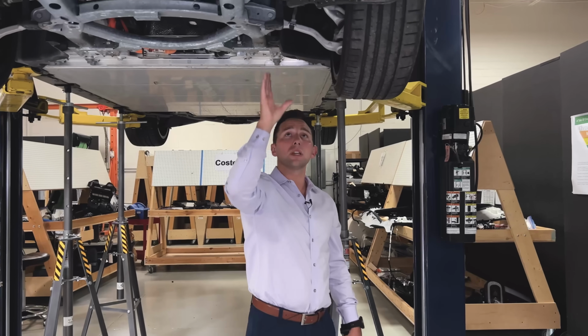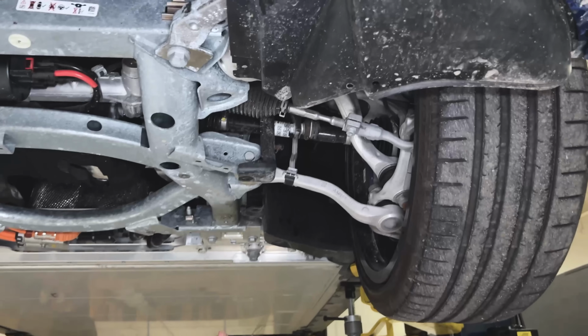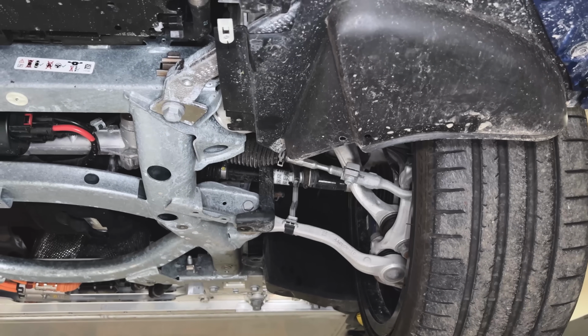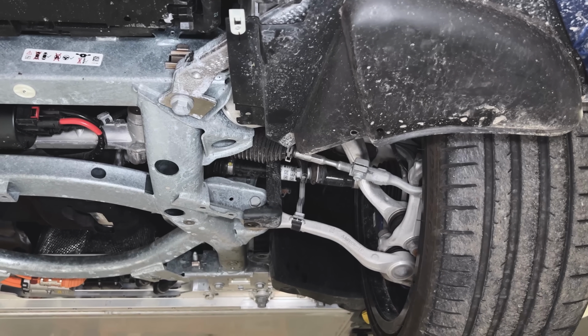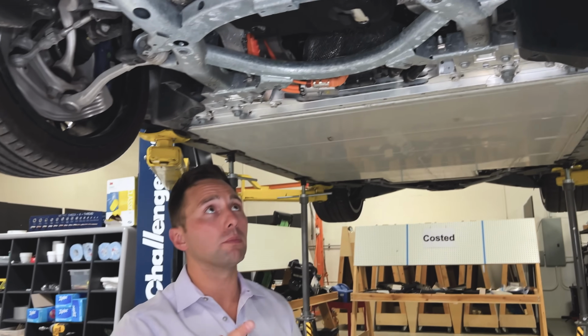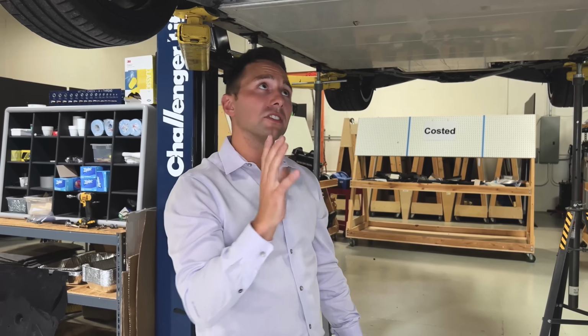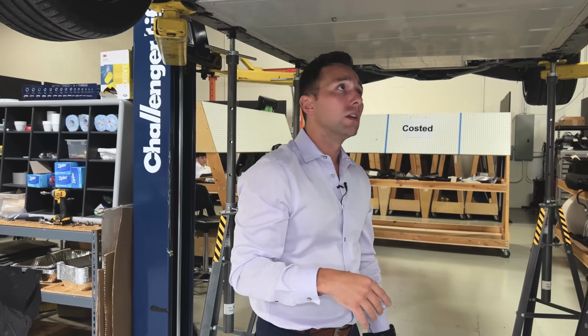This is something that BMW, we've seen quite a few times, execute on to mitigate that wheel stack-up effect. So interesting that they went to a casting versus sticking with a forged component, and seeing how they're kind of managing those kinematics in the event. I'd really be curious to see it crash and see how things actually get out of the way.